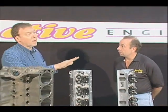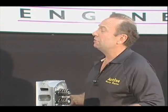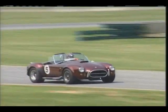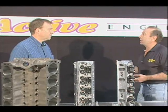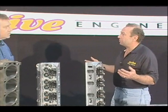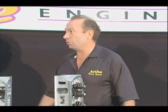So Mike, if we're going to start a project like this, where do we need to begin? What do we need to understand as to what my needs are to build one of these engines? Well, the first thing we do is I sit down with the customer and spend a lot of time talking to him to see what he's going to use the car for. Is he going to drive it on the street? Is it at the racetrack? If it's at a racetrack, what kind of racing? Are there any rules involved? You need to cover off what kind of fuel the customer is going to run, because that's going to dictate what compression ratio you're going to run. You need to talk about how much horsepower he's trying to make, and then you need to talk budget, because some of these can get fairly expensive. There's no point in me designing a motor that's going to cost $10,000 when the customer only wants to spend $5,000.